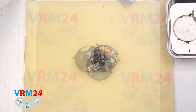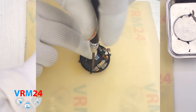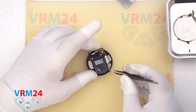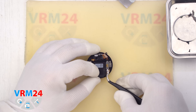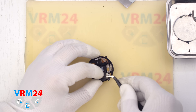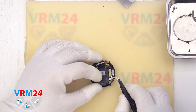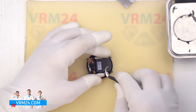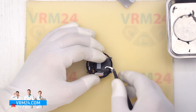Finally we can remove the battery, which is mounted to the back cover. Start by removing the screw that secures the battery connector and set it aside. Please note that this screw is different from the others. We remove the bracket holding the connector in place and use a non-metal tool to disconnect the battery connector. Now we can peel the battery off — start from the edge and lift gently. Don't pry too hard to avoid damaging the battery shell. The battery is now detached.